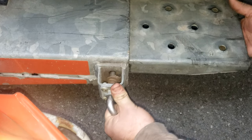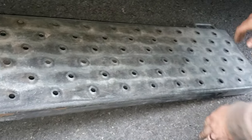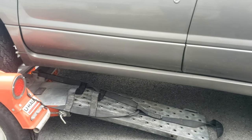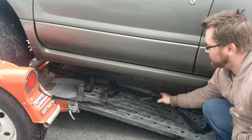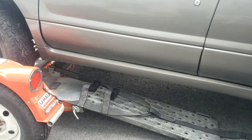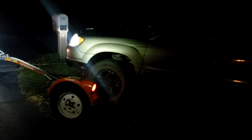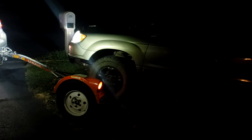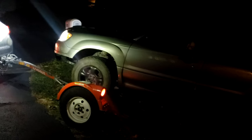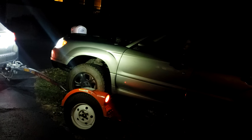With that out of the way we'll start prepping the dolly. Pull the pin out to release the ramps and go ahead and back them out. Make sure your dolly is connected to the hitch. With the ramps deployed, set the straps down as shown so they don't bind when you put the vehicle up the ramp. Go ahead and put the vehicle on the ramp — it might be easier to drive it on and then disconnect the driveshaft, but in our case I had to use my vehicle's winch to tow it onto the dolly. It will set in the valley once it's secure.